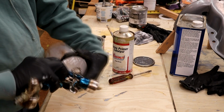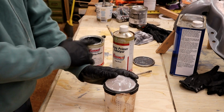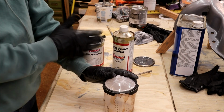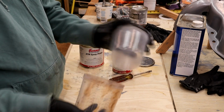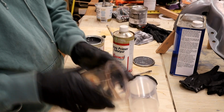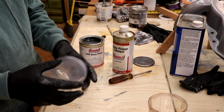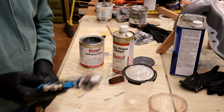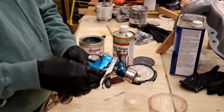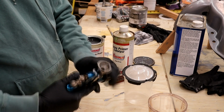And this container, you can put the cap on, but this stuff has a very short shelf life once you've mixed it, so I'm not going to mix very much. The beauty of this system is that you keep this cup, but these liners you throw away, which enables you to quickly change from one material to another. So that's the story of that. If you've got a regular cup, that's fine as well. You just have to clean it out each time when you're changing materials.